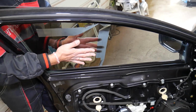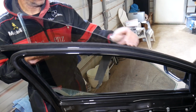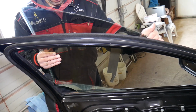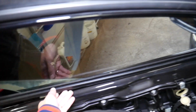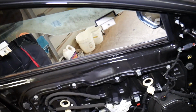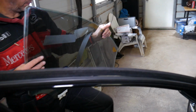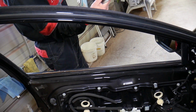So once you unhook it, you can go up on one side, down on the other one, and gently, guys, pull that window out. Okay, here we need to remove that. That thing, we need to remove it, because there is a window guide there. And that's where the two bolts attach to. Check it out, 1 and 2, and the window, you can see, is out of the door now. So completely removed, guys, as you can see, nothing holding here now.